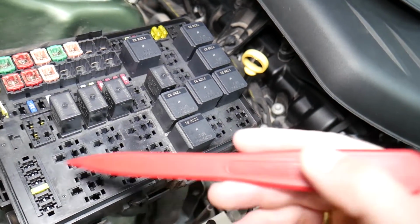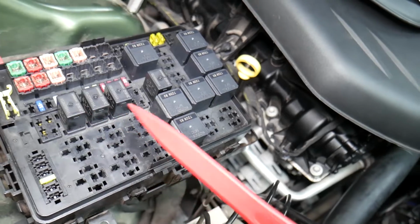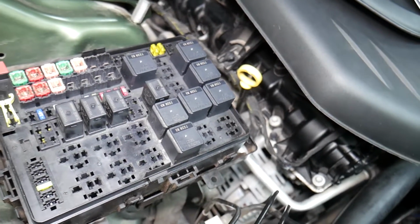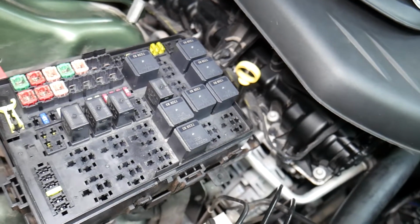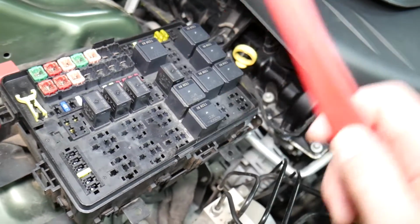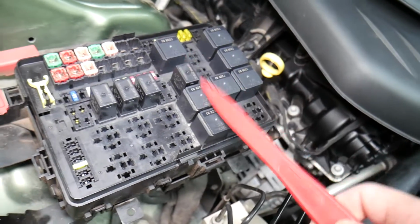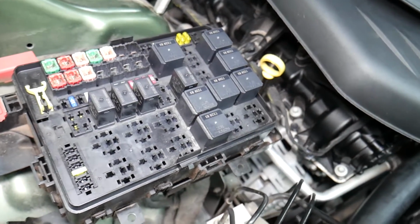And for some certain fuses, guys, it's important to disconnect the car battery when removing them, otherwise you can burn the electronics. And for instance, working on airbags, fuses or anything like that, you need to wait at least 1 hour after disconnecting the car battery. And if you're not qualified and certified to work on airbag systems, I will never recommend doing that, guys.